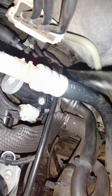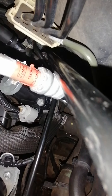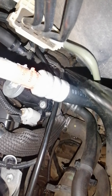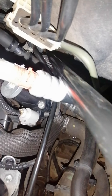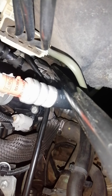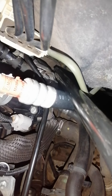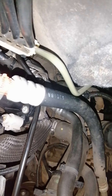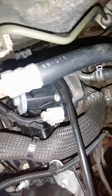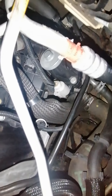This is the pipe that is coming from that side, joined and then through the housing and through the water system to the oil cooler. I just can't get the right angle — I got something to point because my hands are too big. If you check there, there's a top bolt there and a bottom bolt. This is where the EGR blanking plate goes in — you just loosen the top bolt and the bottom one, slide it in, and then tighten them. Make sure they are tight and that the seal inside is on the exhaust side of the EGR housing.